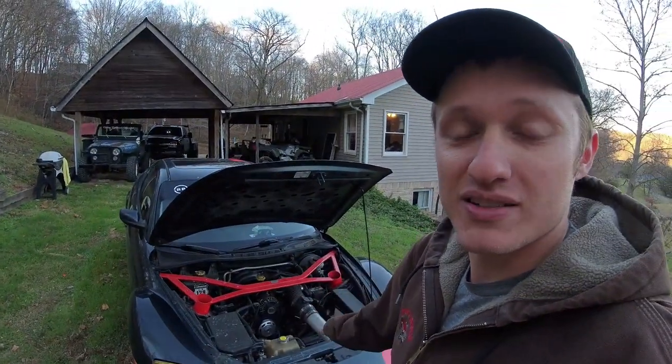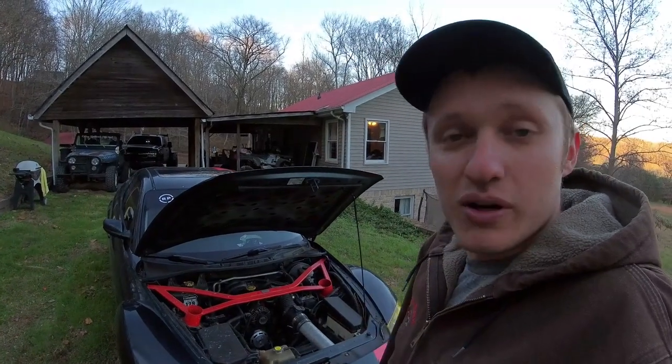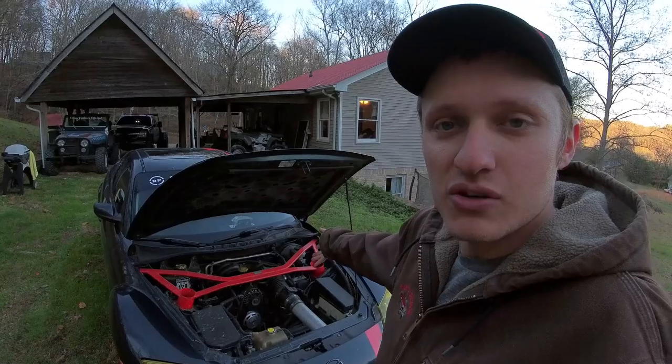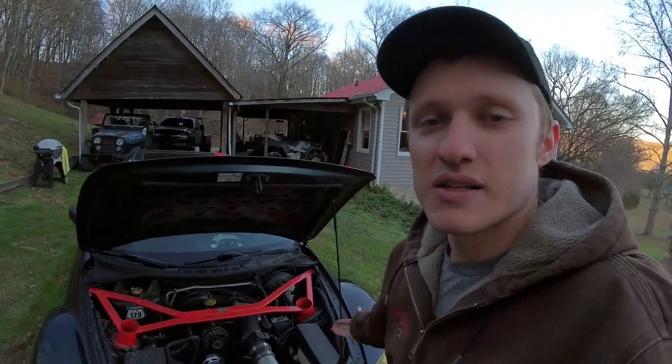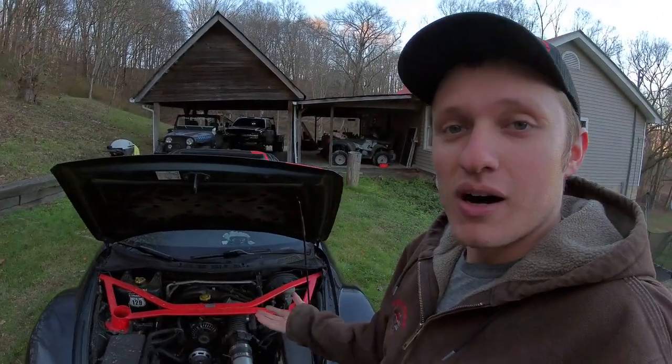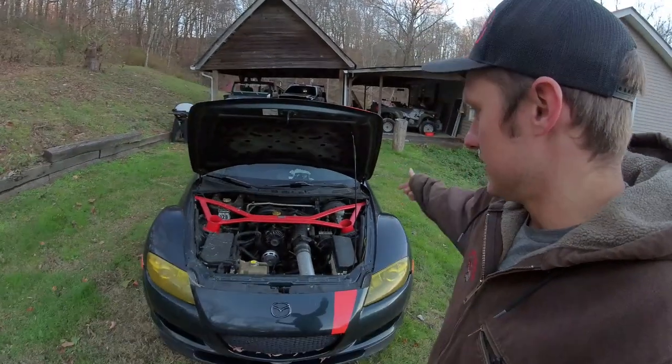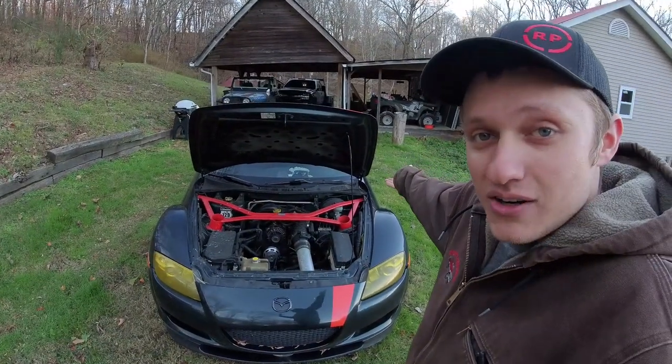I would recommend replacing them every 20 to 25,000 miles if you start having issues, or upgrade them to an LS coil unit. Most of the time the plug wires are fine, but the plugs in these cars can also be very finicky.